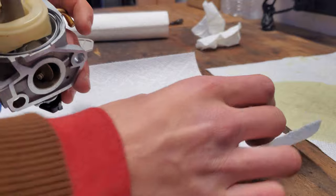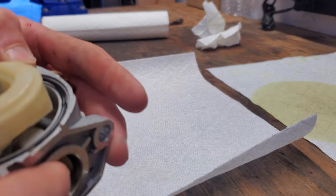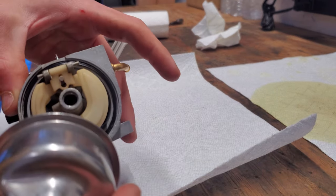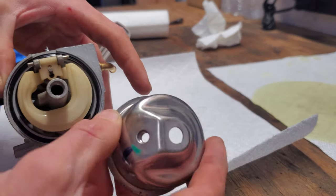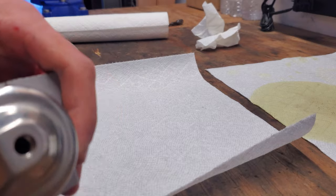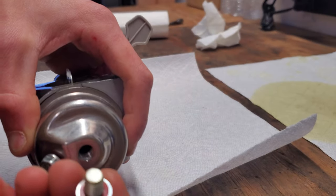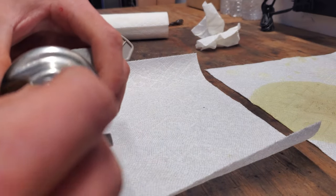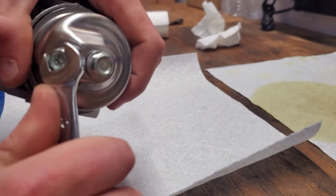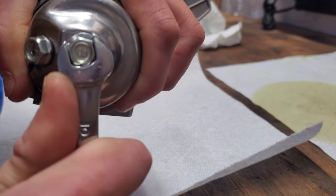If the o-ring is really dry rotted and cracked, you'll want to buy a new one. I'm reusing this one because the machine is pretty new and the o-ring is still in good shape. When I put the bowl on, note that the fuel inlet is right there — I'm going to position the threaded drain bolt on the opposite side so it's easy to drain the carburetor while it's on the machine. Thread it in and tighten everything down nice and snug — don't do it too tight or you'll strip it.